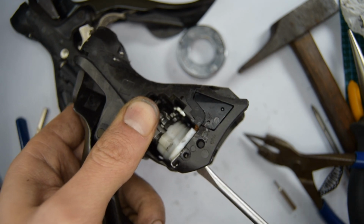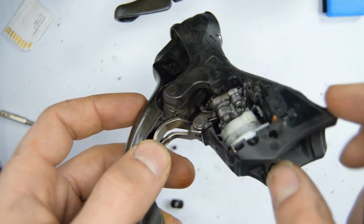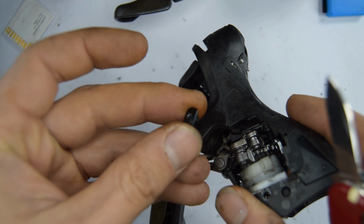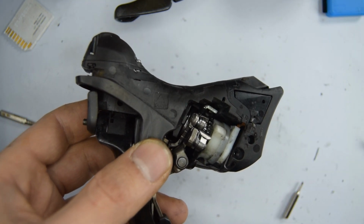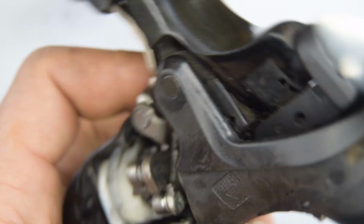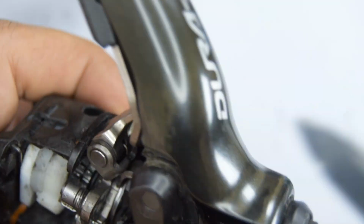So it's a flat-headed screwdriver right there. Looks like to work on this you're going to need to remove the arm. You can't take this out otherwise. In fact, on the other end, there's this kind of female part and it fed out. So it looks like I'm going to need to push it from this way to extract this part out. The little E-clip for this side will be on the, let's say, the left if we're facing that way. It's again the same procedure as the 3-speed.